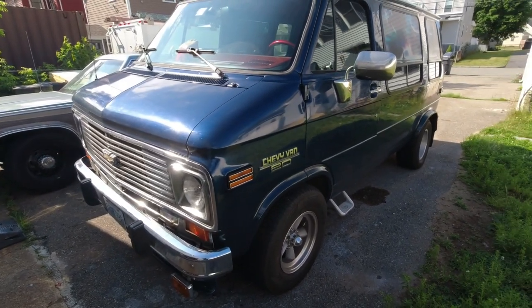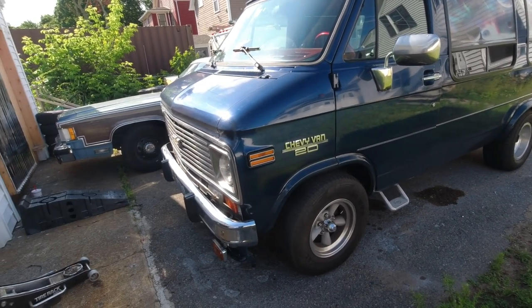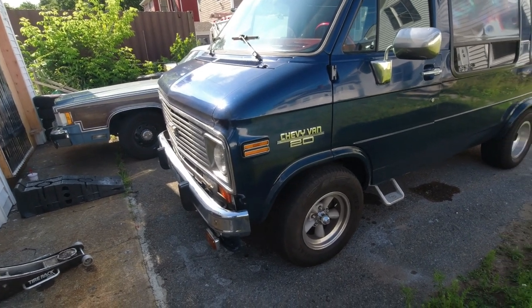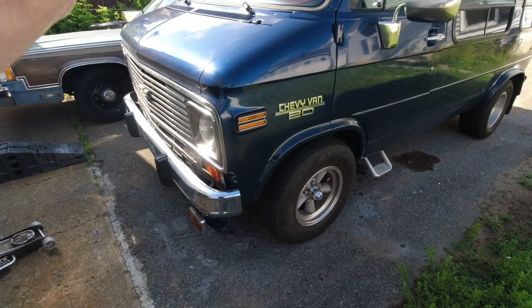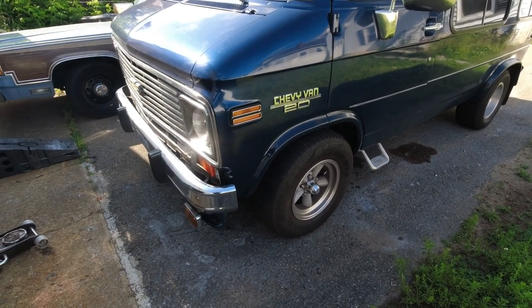A lot of back roads, and the brakes on the front are vibrating really badly under hard braking and there's a lot of slop in the front end. My goal had been a complete rebuild of the front end — ball joints, bushings, tie rods, the whole shebang.